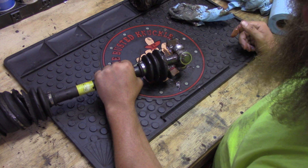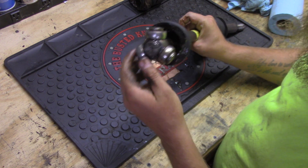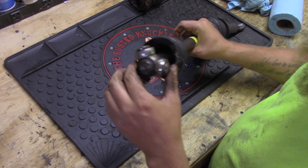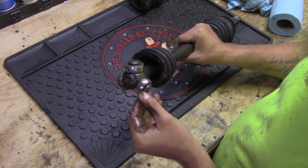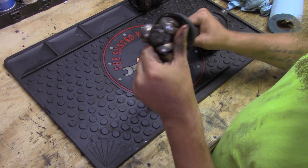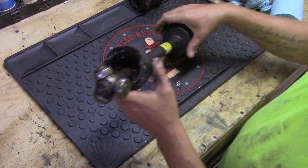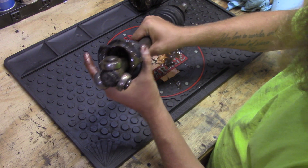What we're looking at here are three tripod bearings and they spin independent of each other. This part here looks like it could be removed — there's some kind of ring there holding it in place and there are splines here. Not that this is serviceable, but it makes sense that they have individual bearings here and that they rotate independent of each other, and that assembly would have to be attached to this shaft. The boot just holds all that grease in there — nasty looking stuff. I'm going to leave that half on there and work our way over to the side that attaches to the wheel.